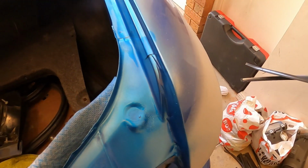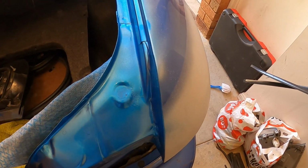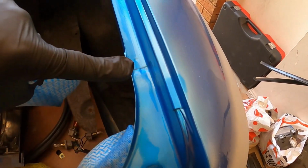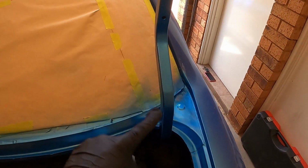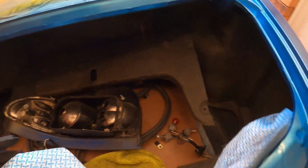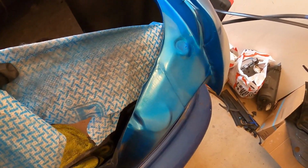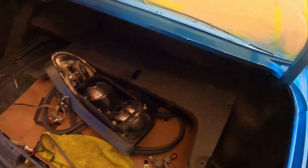Basically, the paint itself is reacting. That only means it hasn't been properly cleaned or sanded. There's some contaminants underneath, and that's why it reacted. Don't worry about it. This area, I've only painted just extra. My concern was this channel itself, because it's gonna be super hard for me to paint it, plus the actual hinge. In case you noticed, I put those rags over here. This is basically in case of overspray. It protects the liners, so I don't need to worry about them.